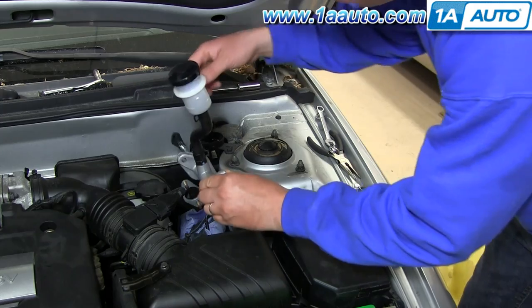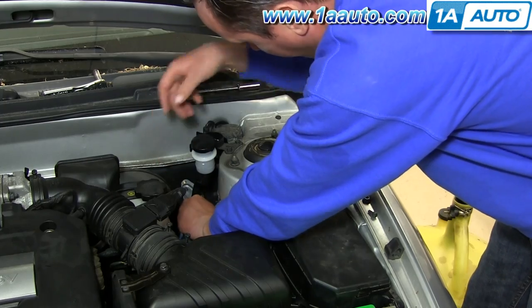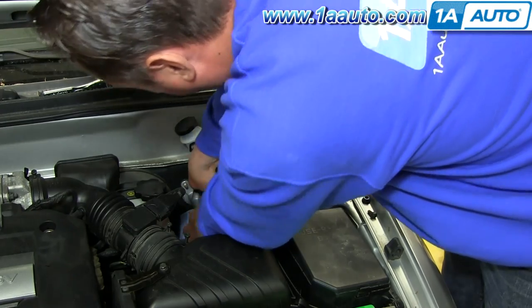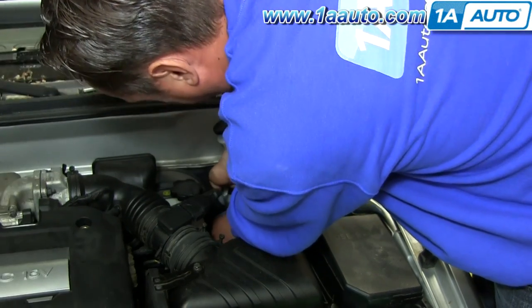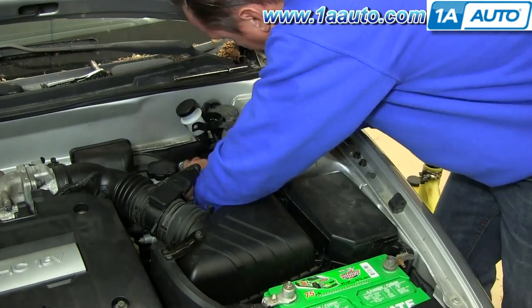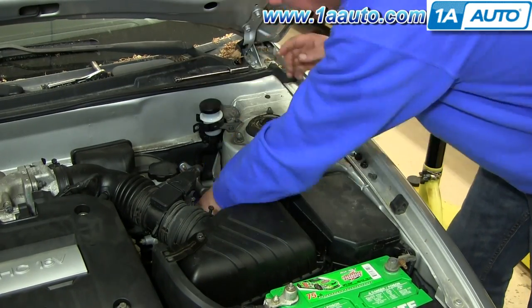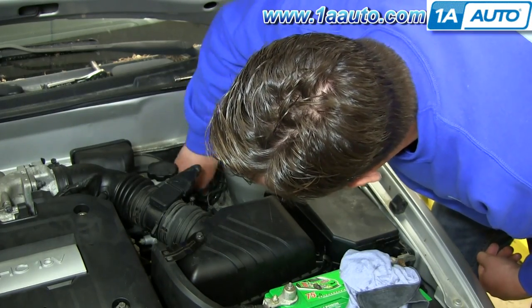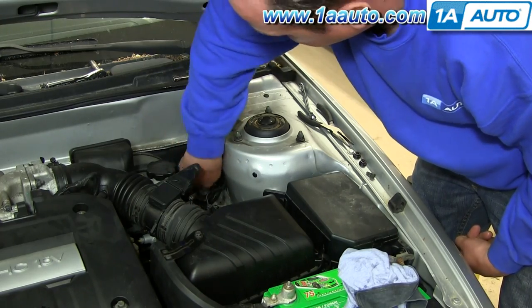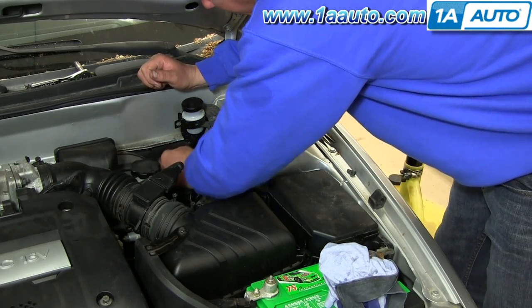I've got my finger over the hole for the brake fluid and I'm just going to line it up on the studs and try to re-secure that fitting as quickly as possible. The first step is to get it in and get it mounted on the studs, then take the line that goes to the slave cylinder and just get it threaded back in and get that tightened up first. Installing the nuts to hold the master cylinder — first thread the nuts onto the studs and then tighten them up nice and firm with the 12mm socket, ratchet, and extension.